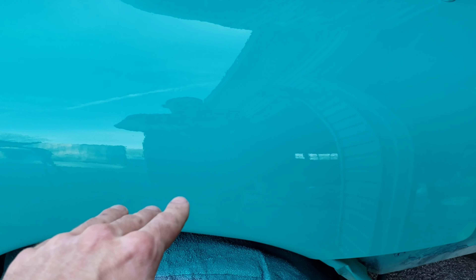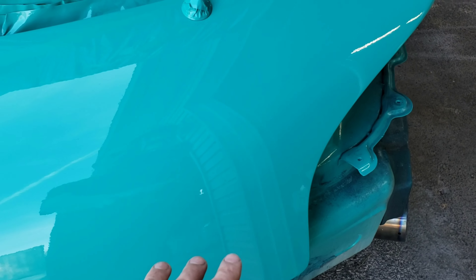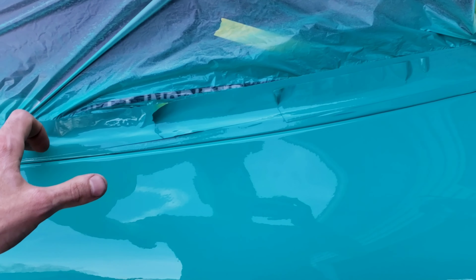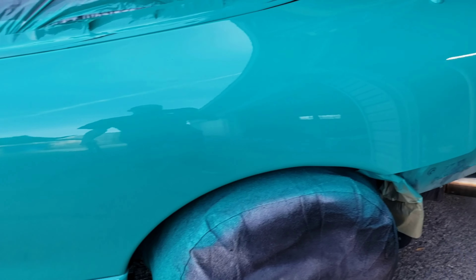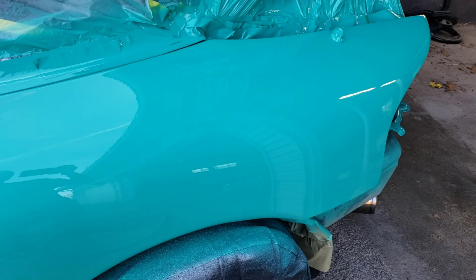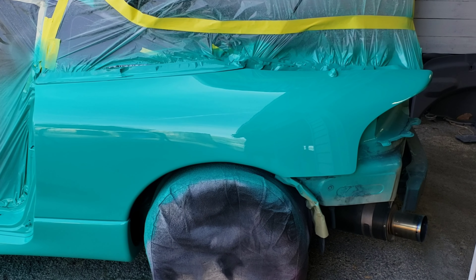I very carefully extracted that hair. I'm going to have to do a little bit of touch-up — I left a little dot, but it just went through the clear. So I took a touch-up brush and put some clear coat in there, and that should wet sand and buff out. A bug did end up landing right there too, but it was in the top — I got it out. It's getting pretty nice and tacky now, not stringing anymore. So anything that lands in it at this point I'm going to leave alone. It's been like 15-20 minutes and so far it's looking pretty good — it's exciting.